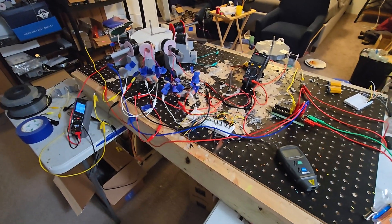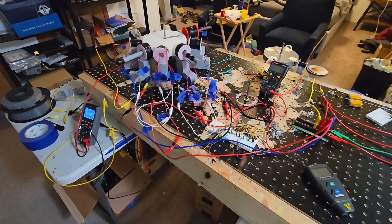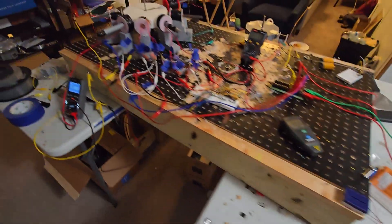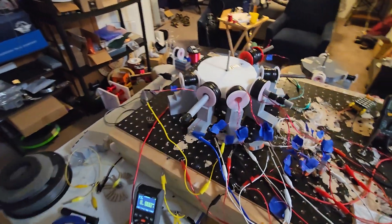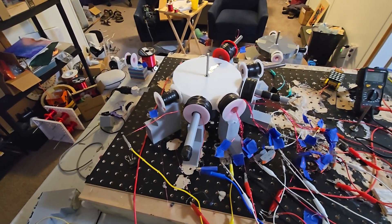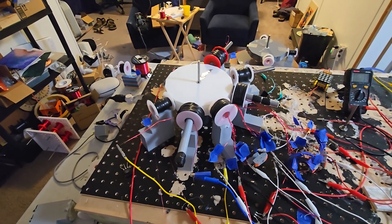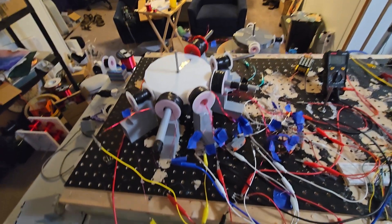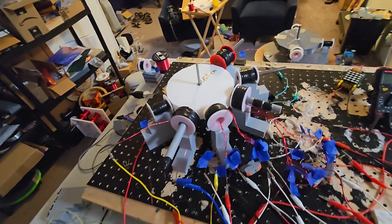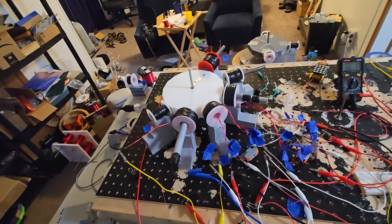Hello ladies and gentlemen, what's up? It's Papa Bale, welcome to the channel. We got 12.5 volts in it and it hasn't been started yet. I got to spin it to start it because it's got a trigger coil — you gotta run it past the trigger coil at a certain speed for it to send a signal to the one transistor that's running this whole thing.